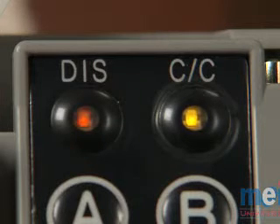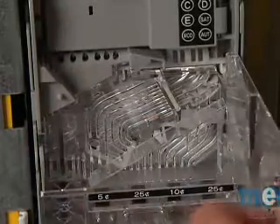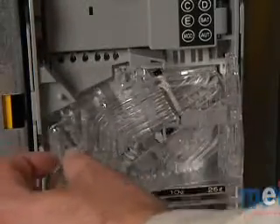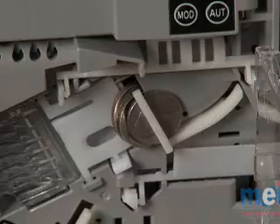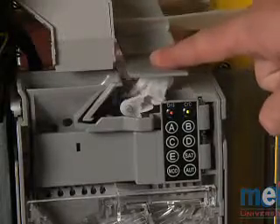The inventory switch contains two LEDs. If a failure is sensed in the discriminator, the red LED will be flashing. This indicates that there is a coin jam or debris in the discriminator where the return lever is stuck. Check for any jammed coins or debris, and for proper operation of the return lever.